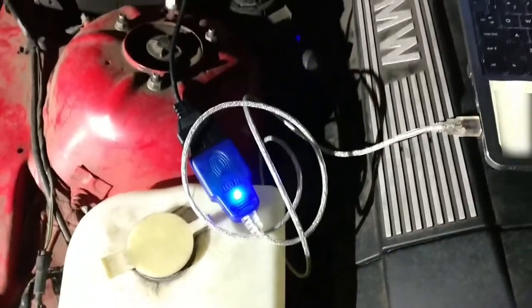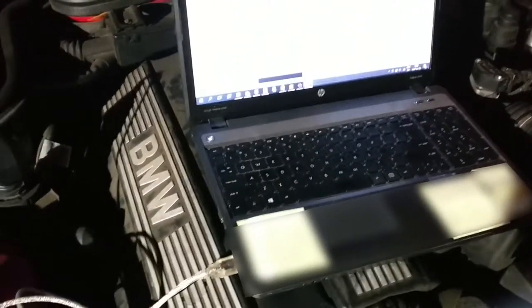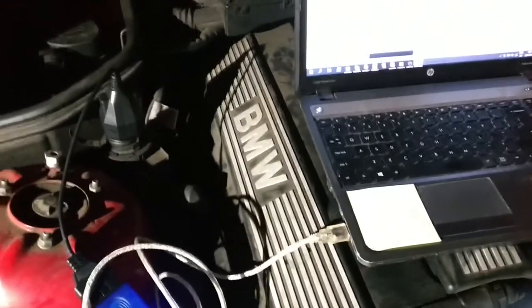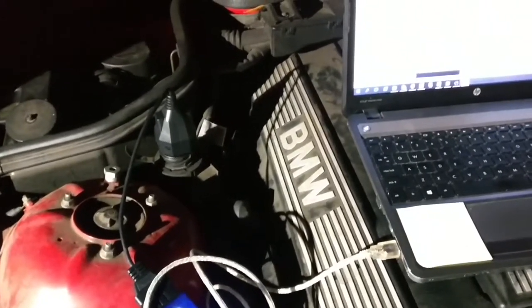All right. As you can tell by the distinct change in luminosity, today is tonight. I took the ECU image, ran it through a program, after a lot of research. The one that I needed was the 24 kilobyte image. That's 24,000 hex values, which is 192,000 binary bits, 192,000 ones or zeros. Out of that, I had to change one bit. I had to flip one bit from one to zero. So, no. From zero to one.